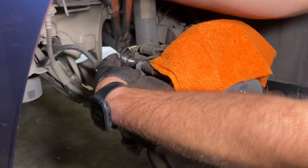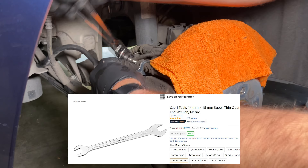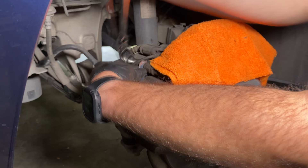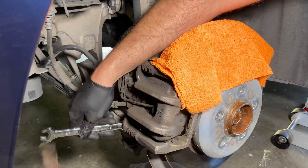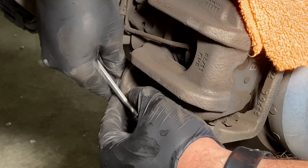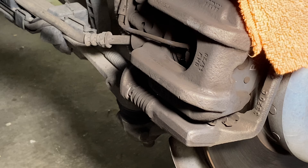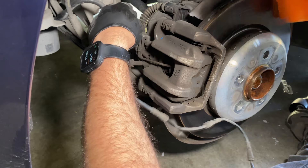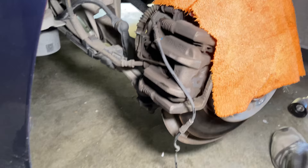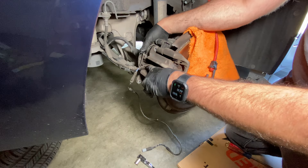I'm using a 13 millimeter socket and a 15 millimeter really thin wrench — I actually found that wrench for changing out saw blades, so it's not a common wrench you'd have in your shop. I'll put a link in the description for the exact one that will work, and you could also use locking pliers. A normal wrench is too wide there. Remove the entire bolt on the top and the bottom. Once that's done you can see the two bolts that you removed — they have blue Loctite, so we'll return that at the end.